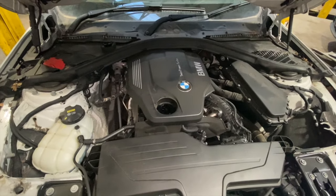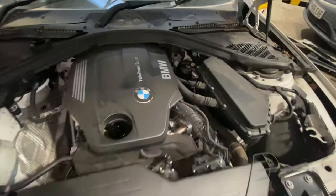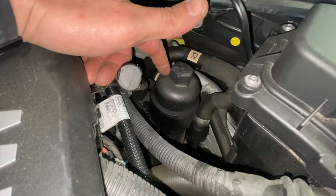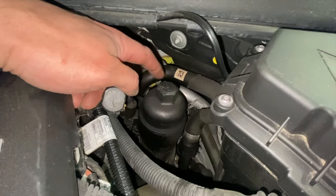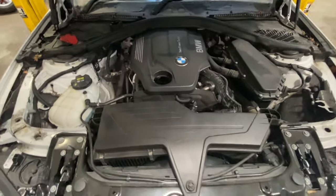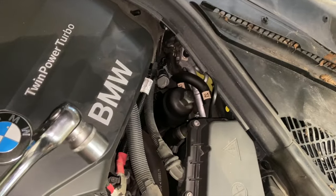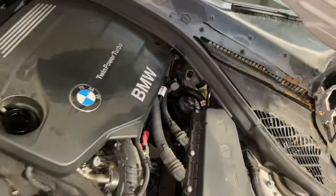The first thing we're going to do is get the oil changed — drop the oil out — and while we've got it up in the air we'll do the fuel filter as well. Coming down to the back here, we've got this cap, which is actually the cap with the oil filter inside it. For the oil filter cap you're going to want a 27mm socket on a ratchet to crack that off and get the filter out. We'll get it up in the air, drop the oil out, replace the fuel filter, then come onto the air filter in this housing, and then do the cabin filter after that.